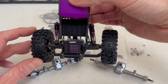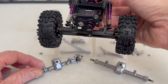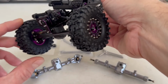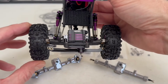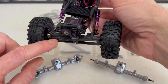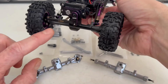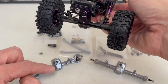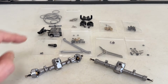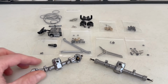You can see this wheel's pretty straight, that one's pretty toed in, and we've got the fixed link in brass, but we're using some off-brand knuckles here. These are like Coda Racing, so there's some little difference in the knuckle. I've got on order the adjustable 349 steering link for this guy. So we're going to steal this brass fixed link and put it on this guy, and since we're using Little Guy brass knuckles, which are no different than these aluminum, there should be no alignment issues there.